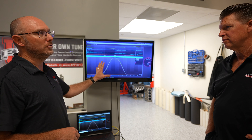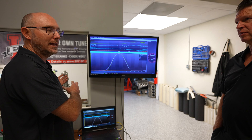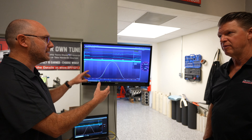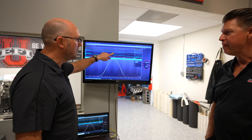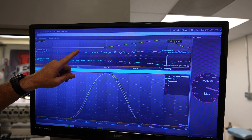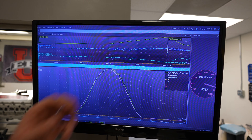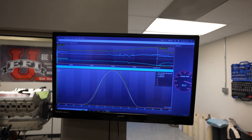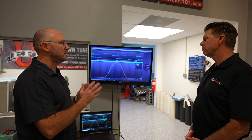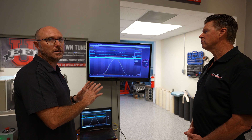What we just proved was we took all that force out of the system and the engine responded amazingly. I actually shouted at the end of the run because I was so blown away by how much better it is. We can see that in both the blue line and the green line. Before, this green line is the duration that's being measured. We started out before, and by the time we got to the end, we were losing about 12 degrees of duration out of our camshaft — if you started with 285, you'd end up with 272 or 273. Just this one simple change has cut that in half. We're now only losing about 4 or 5 degrees of duration, which is normal — we're going to lose something.